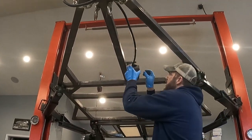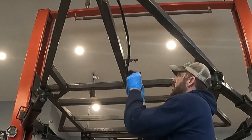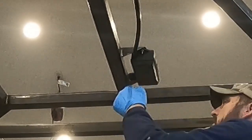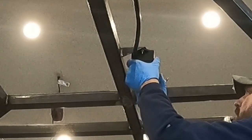I chose this location because the trailer plug will be able to reach the tow vehicle, it's tucked up into the frame to avoid any obstacles when off-roading, and to maintain it in the future, all you have to do is lay on your back and undo the cover.